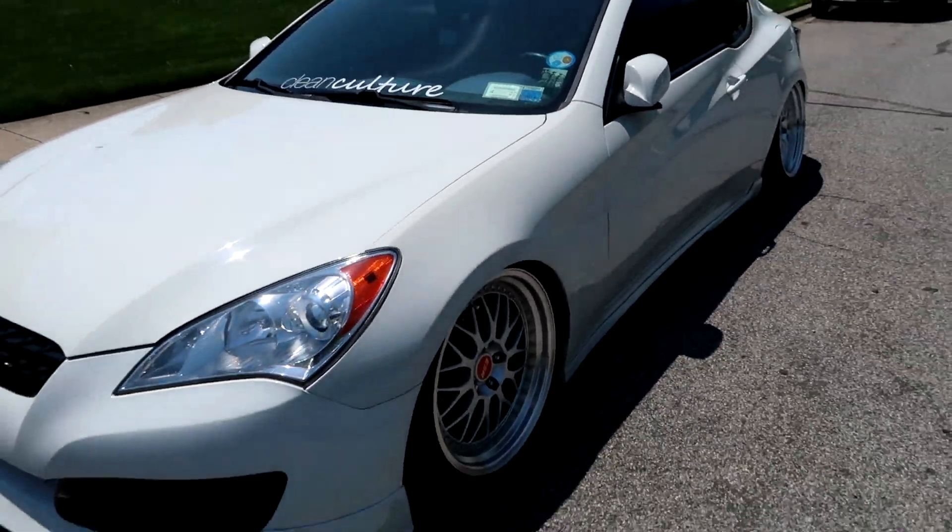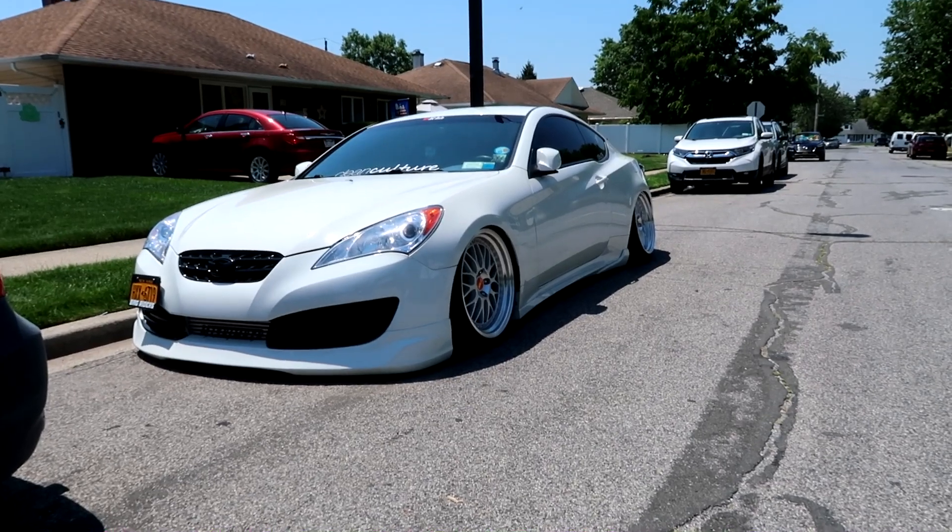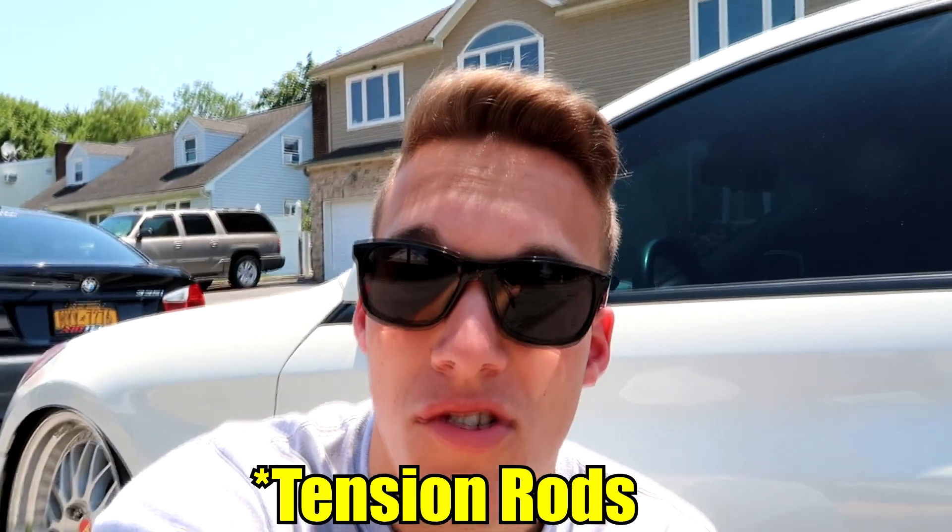I'm going to make another video on installing the tension rods in the front since I do want more camber there — I got the lower control arms specifically for camber and only ended up with about negative three degrees. I'll need another alignment after that unfortunately. Otherwise it looks pretty sick from a distance — the car definitely got lower too with the rear tucked in nicely. That's pretty much it for this video — leave questions in the comments, like and subscribe!